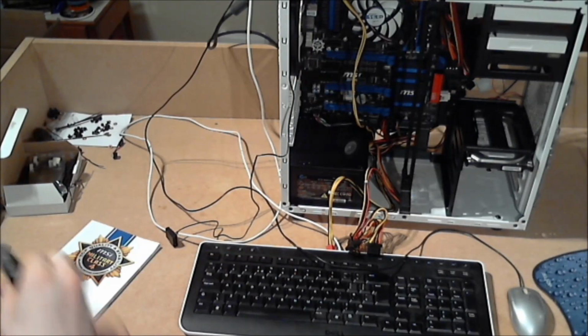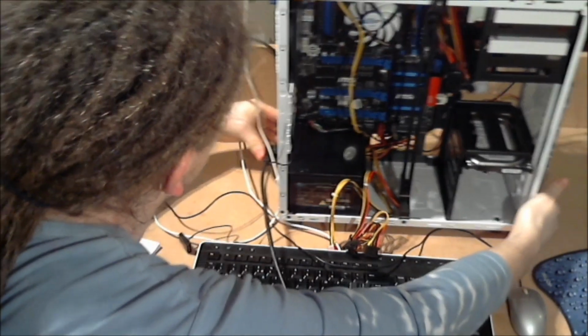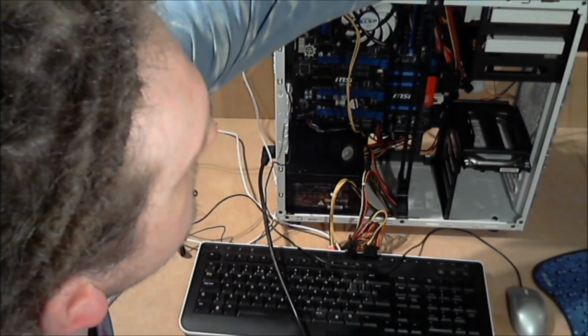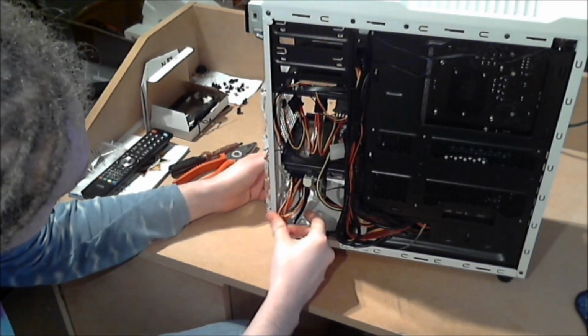There's a yellow cable going up front there. That was a little power cable that goes up near the CPU. And that was what was obviously stopping it from starting. So we hit the button and it starts up perfectly. All fans spinning. CPU fans going. The RAM is lighting up nicely. You see there's a little LED tube that goes along, and they light up blue.